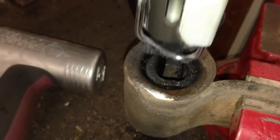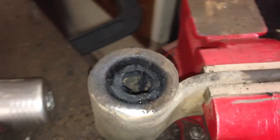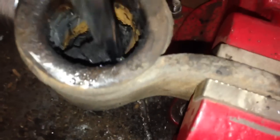I'll cut it one more spot. Now let's see how this thing pops out. Go ahead and enter the chisel inside and peel back on it — when you peel back on it, the inner bushing will collapse. Two hands would be a lot easier, but there it is. That's pretty simple — knocked it right out. Now go ahead and clean up the inside.